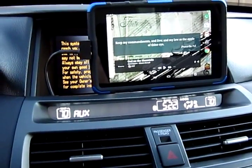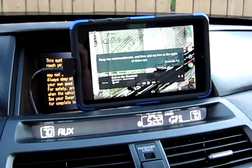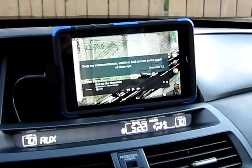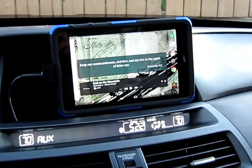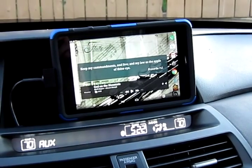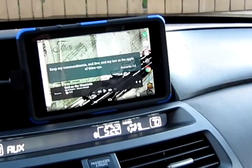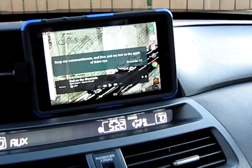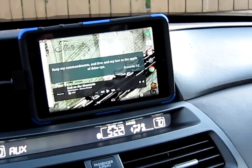I did play around with Android 5.0 Lollipop — I was actually using 5.0.2. Everything functions for this setup on Android 5.0 Lollipop except that the tablet itself will not charge. It will operate in host mode and recognize the digital audio converter and the USB stick using Stick Mount, but it will not charge. With the current setup on KitKat, it actually charges because of the Kangaroo kernel modification that enables fast charging — or any charging at all — in host mode.